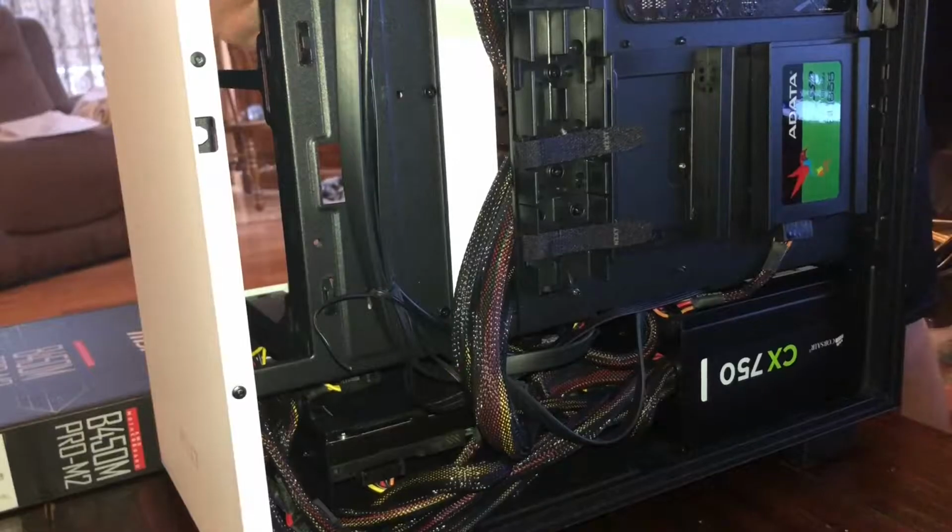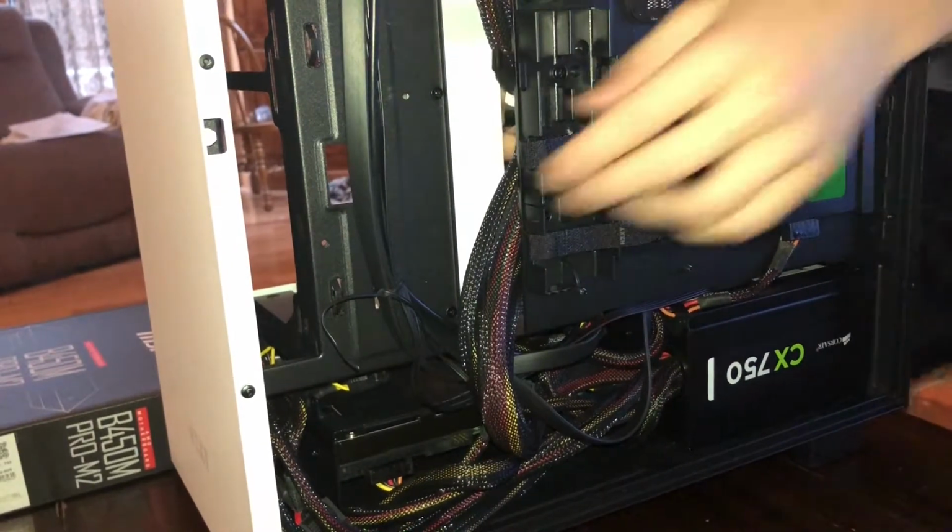Alright guys, so I'm editing the video right now while I'm sick, and I just made a cut in between here, as you can see, but I did this because the 2 SATA cables were connected wrong. One was too short and couldn't reach as far as it needed to, so we just switched them around just to be aware of that. You still want to have your solid state drive as SATA 1 and your hard drive as SATA 2, or mainly it should be your boot drive as SATA 1 and your mass storage as SATA 2. This time.